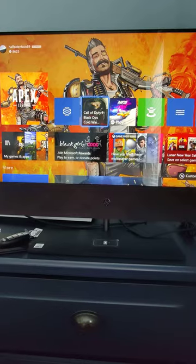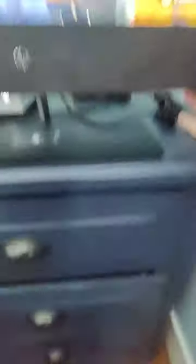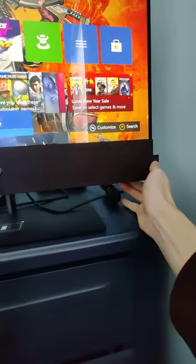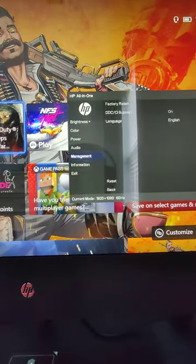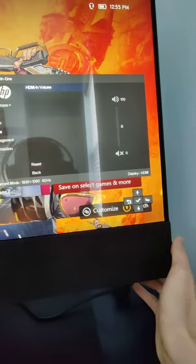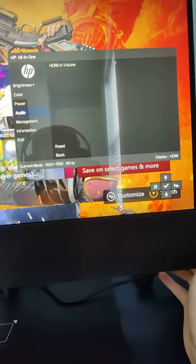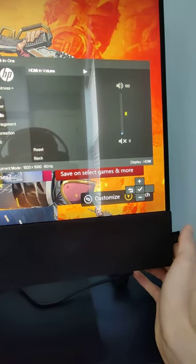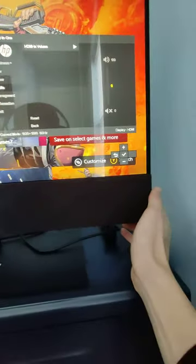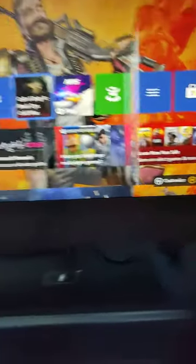To get out of it, you just click whatever button. There's a little scroll wheel on the back of the monitor because your keyboard won't work anymore. You're going to have to click that button and go to your info or any of the menu options. Then go to audio, click HDMI audio, and go up on the pad to control the volume this way. I use a headset so I don't need the audio. So there you go.